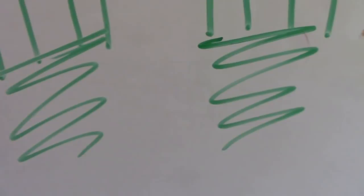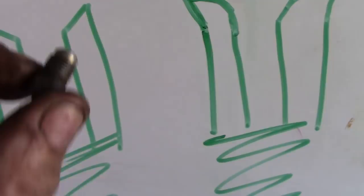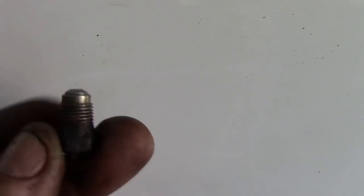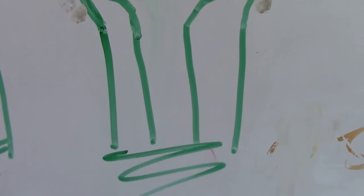Here's a question I get asked quite often: can you use brake pipe flare fittings again? Well, yes you can - providing the sides at the top are parallel, like this. If the tops are flared out, no. Because although you could still get a seal, you'll have a hell of a job trying to screw it in. When it's flared out, what happens is these fittings are actually the same diameter as the thread. These are British or European type fittings where the thread is undercut, so there are a couple of threads missing. When they're flared out, they get so wide they get caught in the threads, and then you get a problem where it cross threads. So not advisable. I'm probably going to check all these out in a minute, but for now we're going to put new ones on.